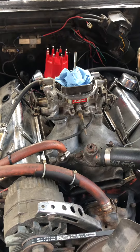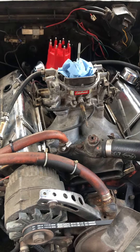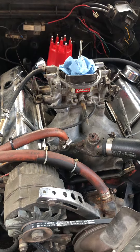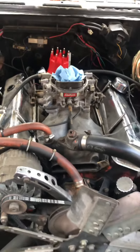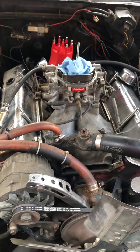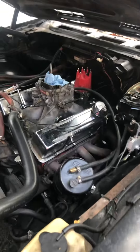Then I'm going to put on the Holley double pumper — that 750 dominator — and see what kind of difference that makes with just the carburetor alone against this ignition system. I don't want to do it all at once because I want to actually see what the individual improvements are. We'll get with you on another video working on the 68 SS. See you on the next one, thanks for watching.